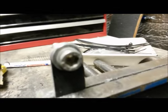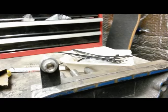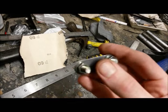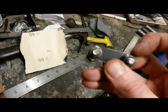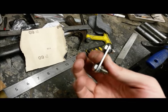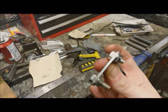A quick way just to get a nice curve on it, just a bolt and a washer on that. There you go, is that in focus? So I can just do my fine bit of sanding and smoothing to get that spot on, and we're getting there. I'm getting a little bit carried away, just wanted to get it really bang on, so I stuck some bolts through two nuts so I can work off them to get the edges bang on round, and these completely flat as well. And I think I'm happy with that. I'm just hoping now that the measurements I've lifted offline, because obviously I haven't measured up myself on the bike, do the same thing. But all being well, that'll be our blanking plate.